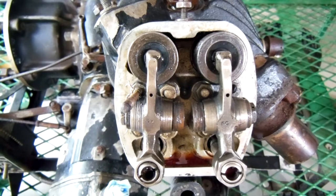So what we're going to have to do now is lap the valve. If you're not familiar with this process, there are tons of videos on YouTube of people lapping valves — some with good technique and others with scary techniques. Basically, the process entails putting a grinding compound on the face of the valve, reinserting the valve into the guide, and then rotating the valve back and forth to grind in a smooth mating surface where the valve face and the valve seat contact each other, which will create a tight seal when the valve is closed. My best advice to those who have never lapped a valve before is to go slow and take your time. A lot of people will use drills to spin the valve and save time, but I do not recommend this at all if you value your engine. Remember, if you mess up, you can't just go out and buy new parts for these engines, so do it by hand, get a feel for it, listen as you're going along, and take your time.